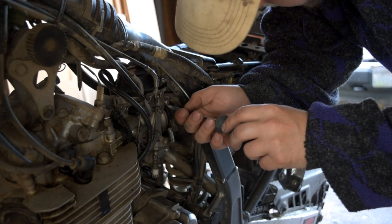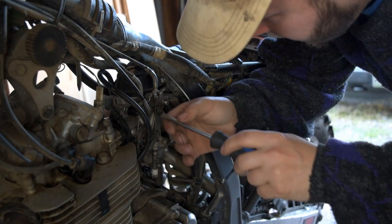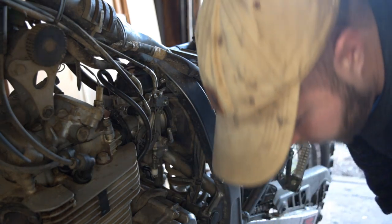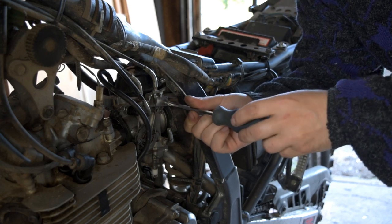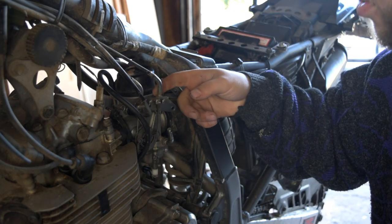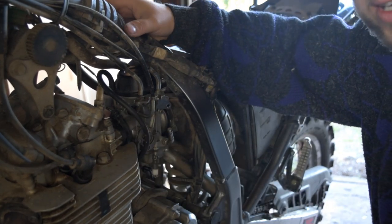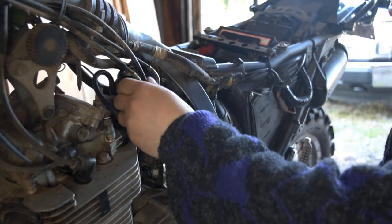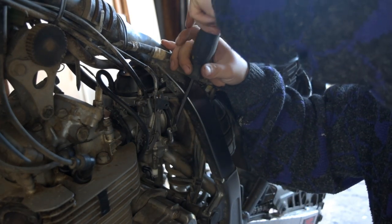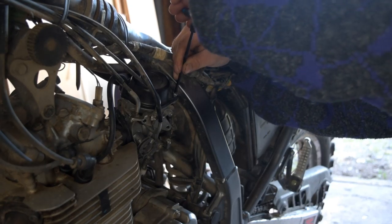Now because of the work we did the other day, today's job becomes pretty simple since we've already had all this off once. Remember we cut a chisel tip in - we've already had this all off once, so we don't have to struggle. We replaced the bottom screws with Allen heads, so we have those nice clean Allen heads there. Remove the throttle assembly here. Some people remove the choke, but I find as long as you loosen up the keepers on the frame it leaves enough play that you can gently rotate the carb. Once you loosen up the two boot clamps, you can rotate the carb - just make sure you keep your choke cable with the rotation so we get at the top first.